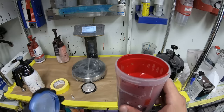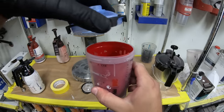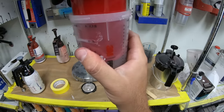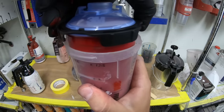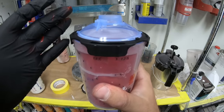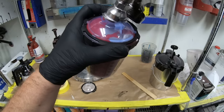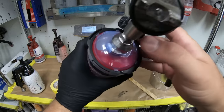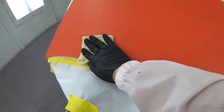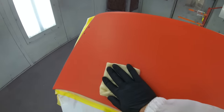For those of you having problems spilling with these liners, it's because you're doing it wrong and you're in a rush. Don't be in a rush — put it on, clip it, hold it up, check to make sure everything is sealed, then seal it down and give it a quarter turn. She's good to go. You'll never have to worry about it pouring out while you're painting. Our special adapter clips right in with a quarter turn and we are good to spray. As a final line of defense, I'm using a tack rag, going over in one direction to remove any last-minute lint from the trunk.